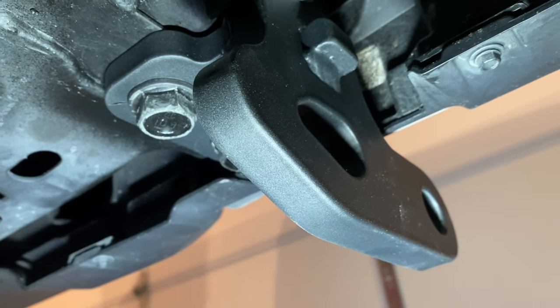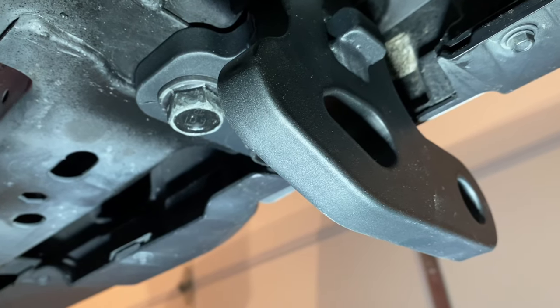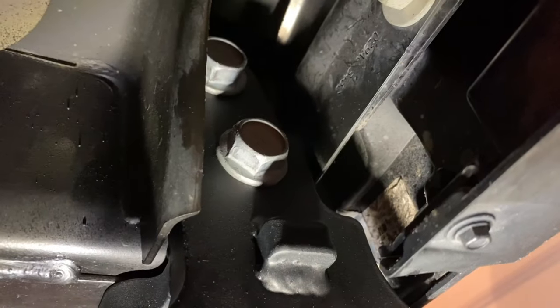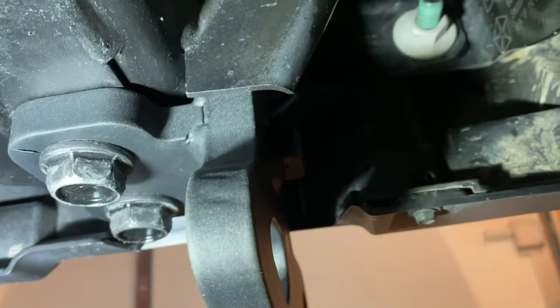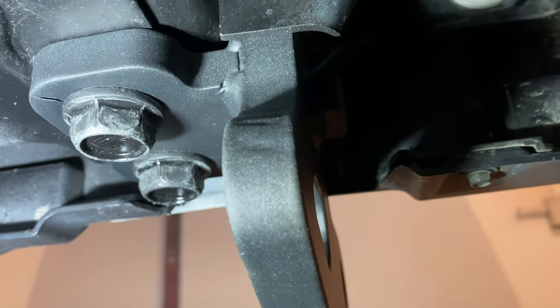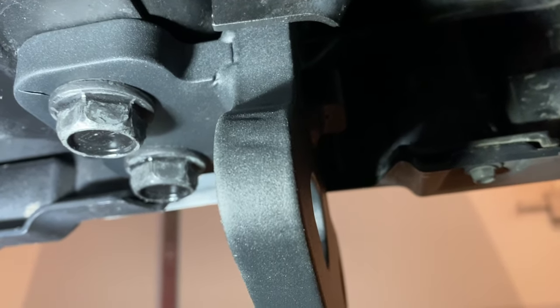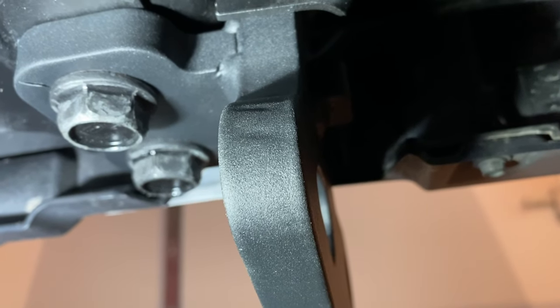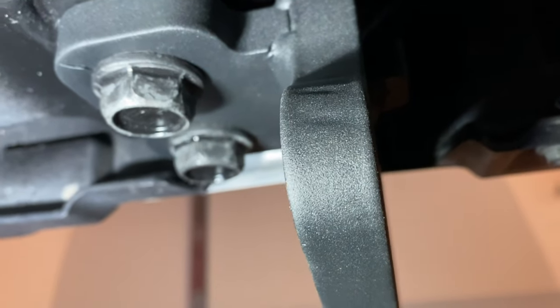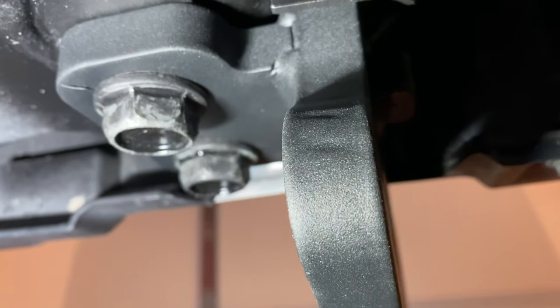Now on to the driver's side. I've completed the installation of the rear tow loops and I want to show you how I decided to tighten these down. I started up here, snugged them up, came over and snugged these up a little bit. I hit it on the back of the tow loop a few times to take out any slack. Obviously if you're going to recover from the rear, you're going to be pulling it toward the rear, so I want to take out any possible movement if it got yanked on pretty good — it's already going to be at the end of its range of motion.